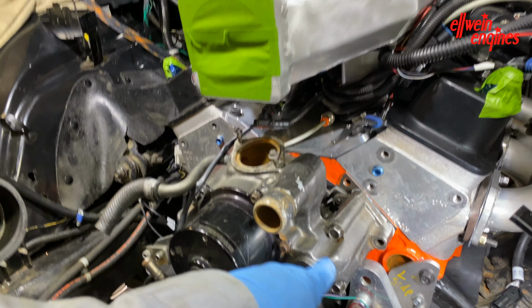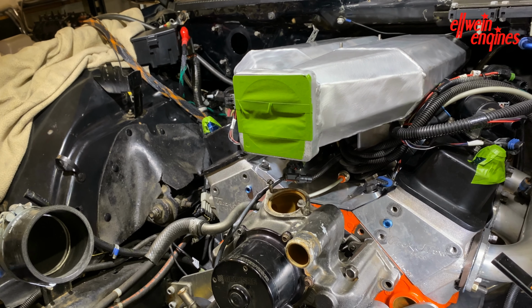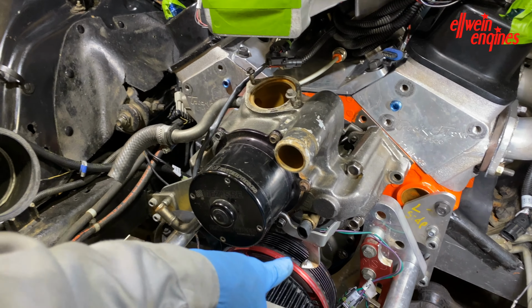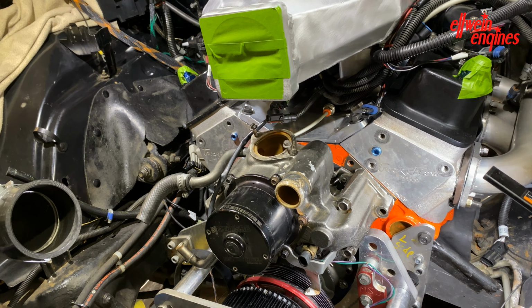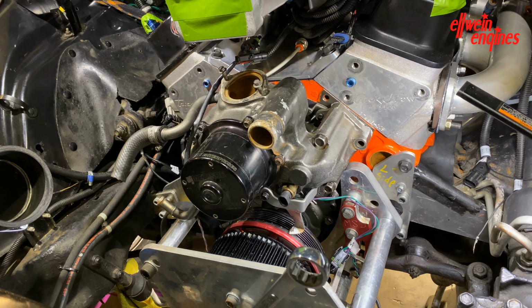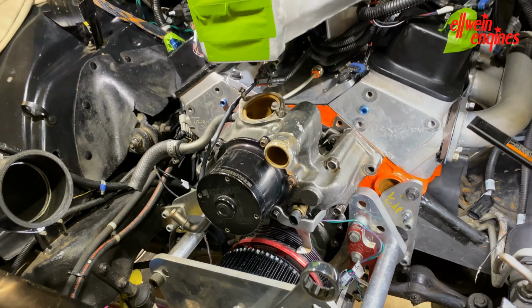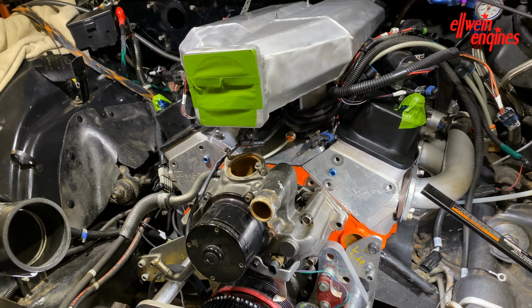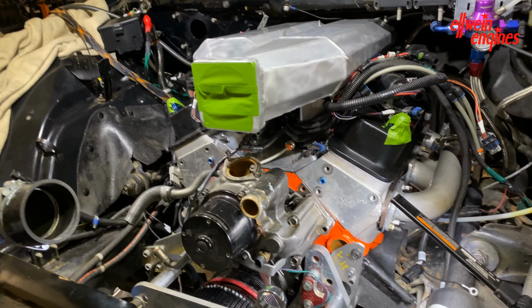Now, that's basically what I've been learning about the computer that's relying on cam and crank signal to know where number one is. It just needs to know from the cam before number one. So when the cam pulses in, in this case at 100 before top dead center, the computer knows, hey, the next cylinder is number one. Then the MSD rolls by at 50 before, that's number one, and then it can do its calculating and fire in sequence until it sees the cam again after 8 pistons, then start over again with number one.